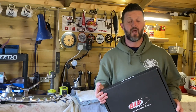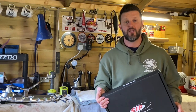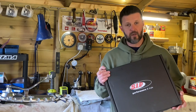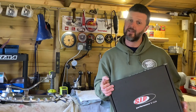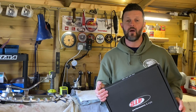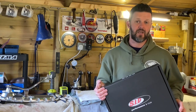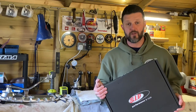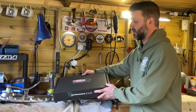It's for my own TS1 240 engine that I'm building — if you haven't seen that one, check it out in one of the other videos. It comes with the option of Li taper or GP taper; I've gone for the GP taper for my own build. They also do a road version, which is the static, or the sport, which has a variable curve on the CDI for adjustable ignition timing.